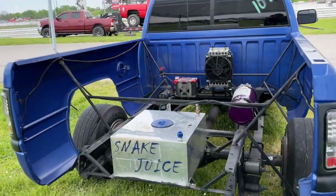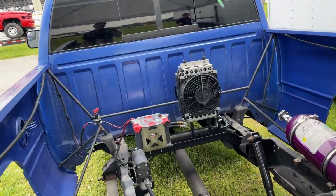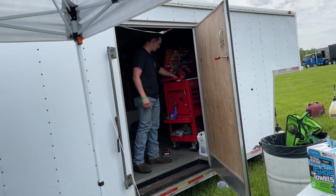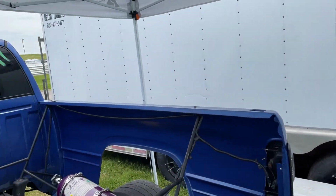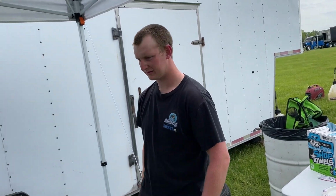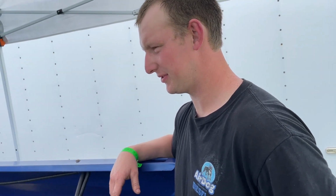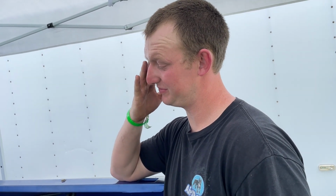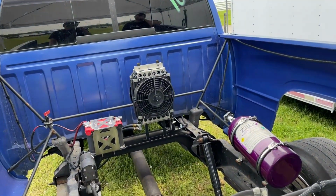She's moving today. Like we said, guys, I think the second gear, in the second gear servo, there was an O-ring that was blown on it whenever we took this apart, and we think it wasn't really applying second, so I think that's why it's going so much faster right now, because other than that, nothing's really changed. I mean, it has second gear now. You couldn't really tell before. It just feels way different. It feels way better now. I got that O-ring fixed, found that when we took it apart, but everything's good, so yeah. We'll just wait around and see if we can make the eliminations.